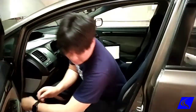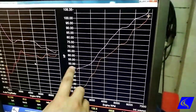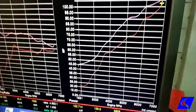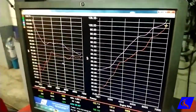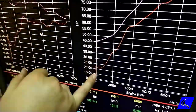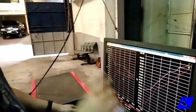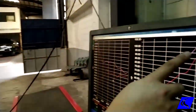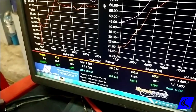We're done tuning — let's look at our final output. The red baseline line is 102 horsepower with the intake, right about what we expected. After tuning, the purple line shows a pretty significant gain — at the very peak at 7,000 RPM it's plus 6 horses, which is normal since the car still has a stock exhaust. But the really big increase is down low: 25 horses gained at just 1,800 RPM, and torque doubled from 60 to 125 also at 1,800 RPM. There's a consistent 10–15 horse gain in the middle as well.